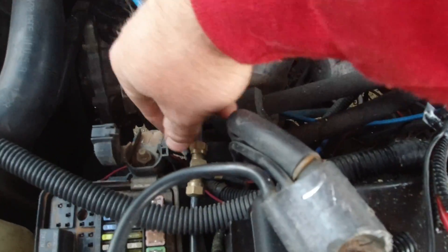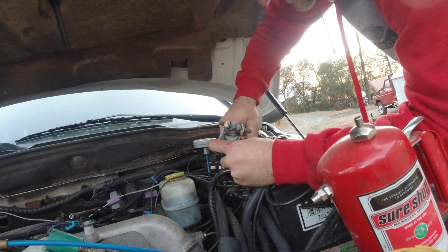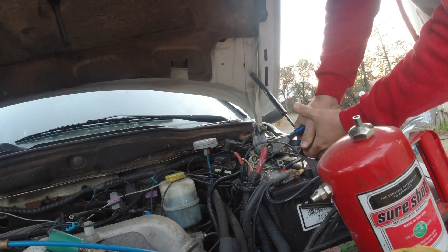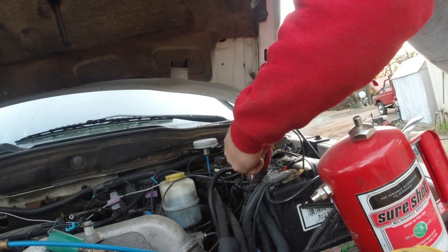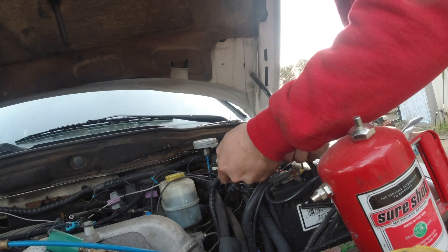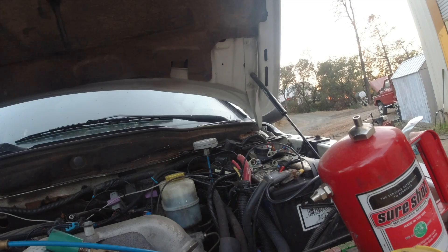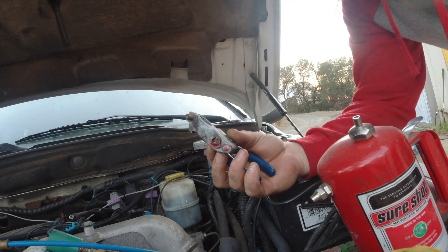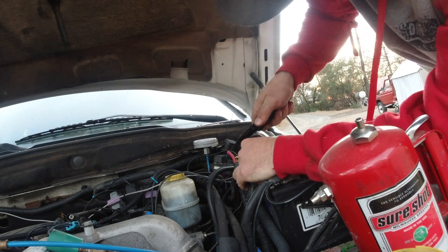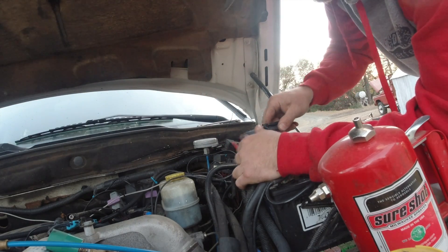Before I jump to conclusions I'm going to go ahead and order some Amazon terminal ends. This one — how's it look in there? It feels solid but this thing is corroding inside the block. Long-winded two minutes of just telling you: we got corrosion inside the battery terminals. My hunch is because I was messing around with this thing. I'm going to check the little wire that goes down to here — it's just fine, I don't see a problem there, it's tight. I found the thing, which is — this one's starting to crack but I don't like cutting these factory ones unless they're junk, and well, we're finding out.